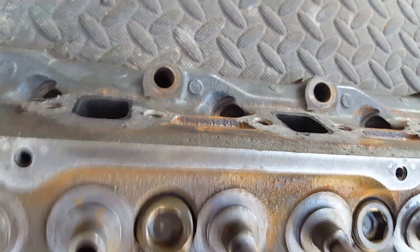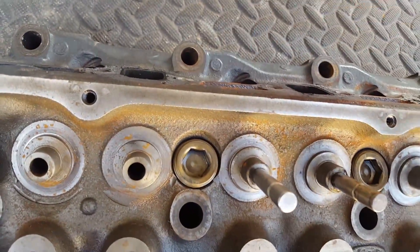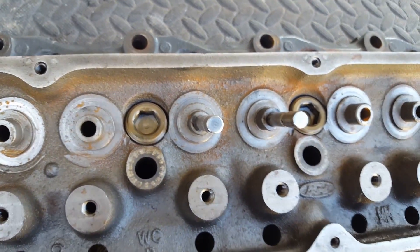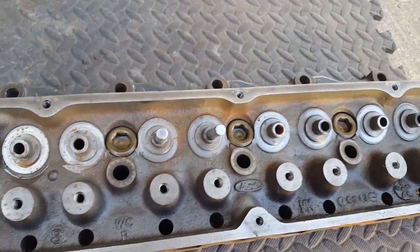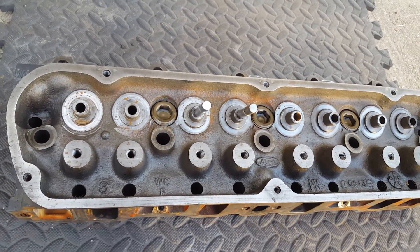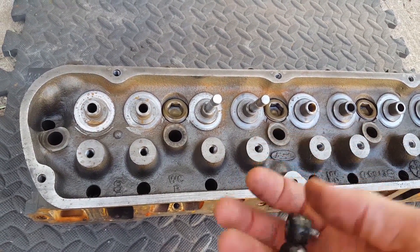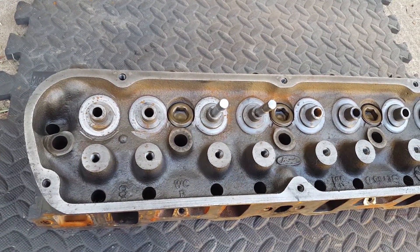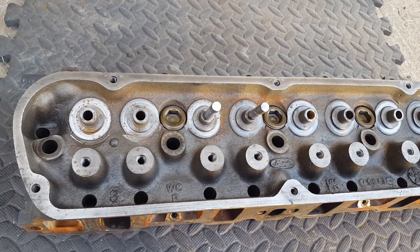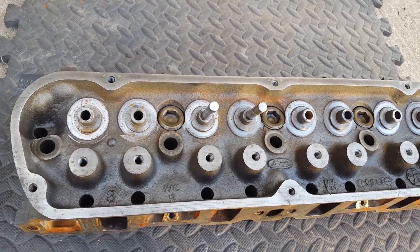This little fitting comes in some of your compression testing kits. You'll actually have a fitting that goes in there and you just hook it up to your air compressor and it keeps these valves up. That was the whole cause for my OMC Cobra to start leaking a lot of oil. I hope this video helped, and if you guys like my videos, feel free to subscribe, share, and have a good one. Take it easy everybody.